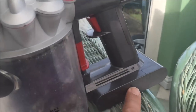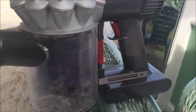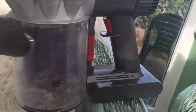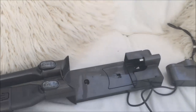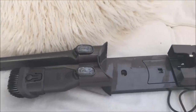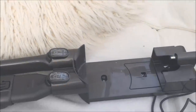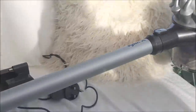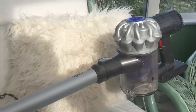This is actually where your battery is. And this is the release valve for the bin — I've knocked that off a few times and emptied the contents in the room, so when you're holding the trigger make sure you don't accidentally hit that or everything you've just vacuumed up will be back on the floor. This is where the digital motor is and it's got a little filter in it as well. This is the UK version — it looks very similar in the States but with a different bit on the end. You've got a couple more attachments and you dock it in here. The cable comes separately; thread it through the plastic bit, pivot it up, and you can fix it to the wall or lay it down to charge. You do need to leave it on charge all the time — you get turbo mode in about 6 or 7 minutes and normal vacuum in about 20, so every time you've finished you've got to put the unit back on charge.